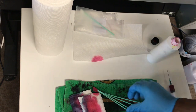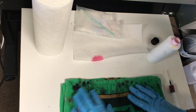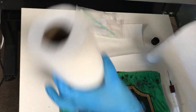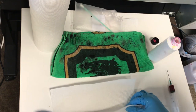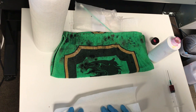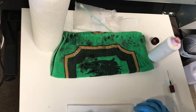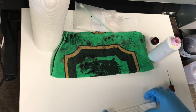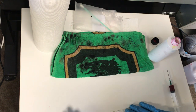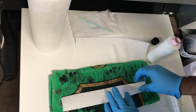Now we're going to clean the surface of the printhead. I have tape covering my vacuum ports, which has worked for me. We're going to do what's known as the paper towel method. You may need to cut a full-length paper towel in half and fold it over more than three times — with the printhead you want a little friction but not so much that you damage the head. We're going to saturate this paper towel with cleaning solution first.